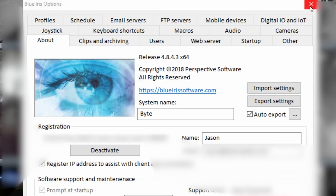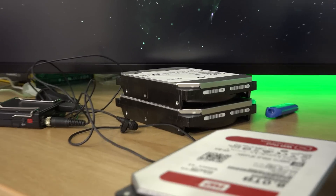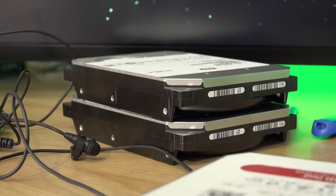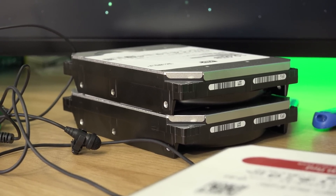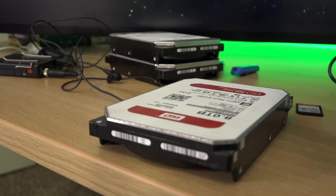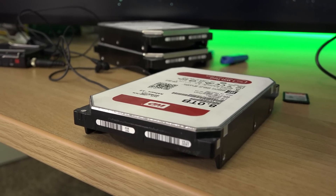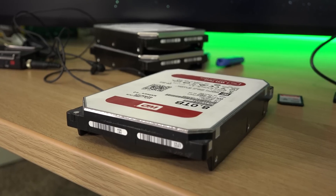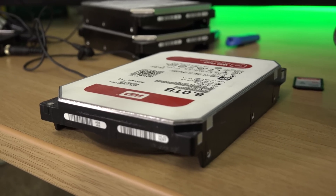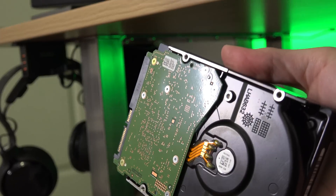Exporting the settings will allow me to save my settings to carry over to the new system. Here you see the hard drive I'm going to put in. I originally shucked three — actually four, but three in a video — these 10-terabyte Western Digital drives that came in the EasyStore USB 3.0 enclosures. I was going to utilize one for Blue Iris while putting the others into Zeus, but I decided why use a 10-terabyte for DVR when four terabytes holds a very long time of footage? So I'll put all the 10-terabytes into the new server and utilize one of the old 8-terabyte drives in the Blue Iris server.